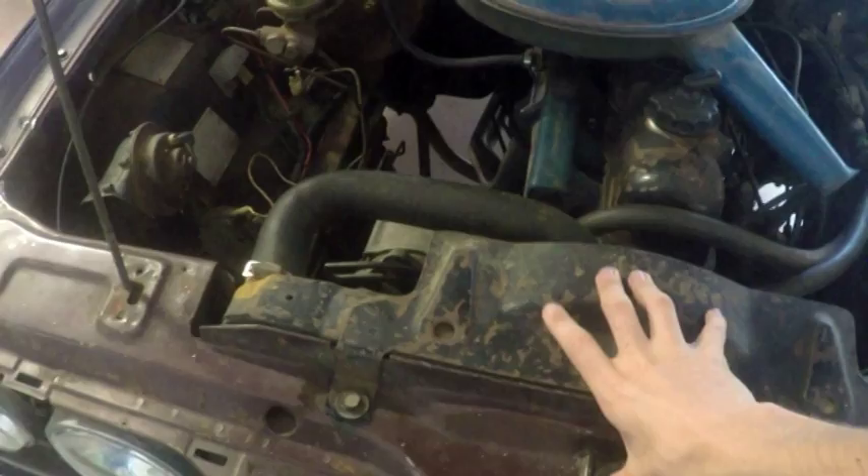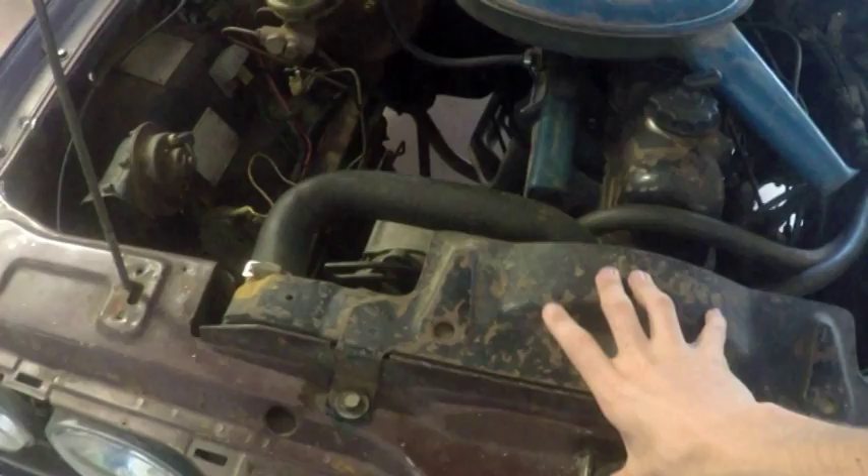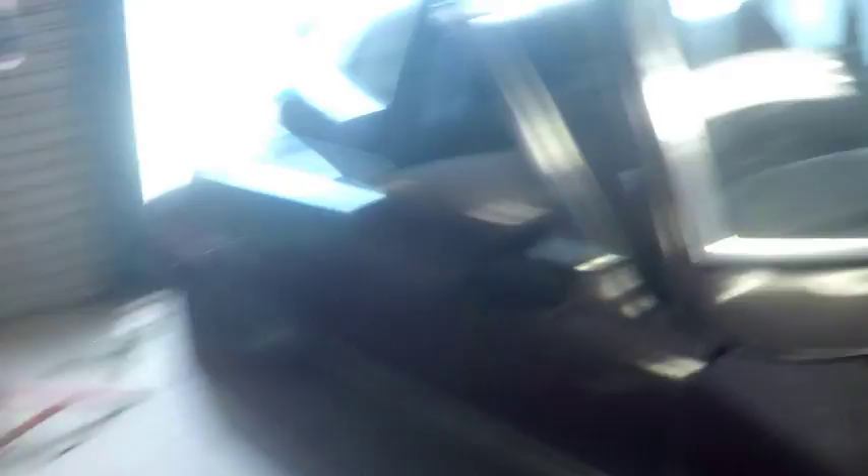So this is the Cortina bonnet, and after we had one snap, we've replaced the cable with a stainless braided cable and it nearly quite pulls it back in there, but it doesn't quite go all the way. We've got our three clamps that hold the conduit — there, there, and that. The only thing we've thought of is that it's got this much movement before taking up the slack.